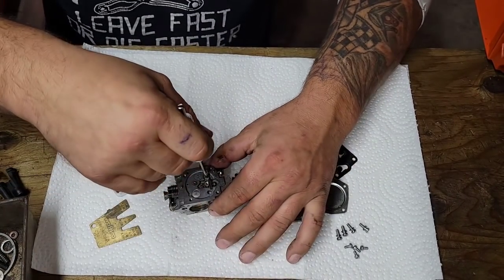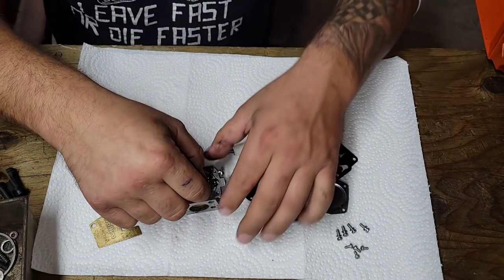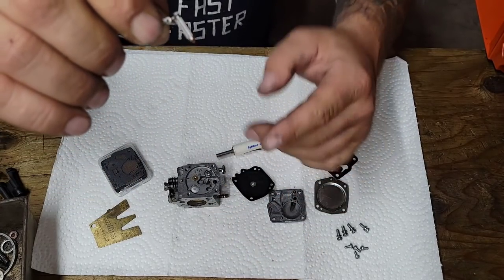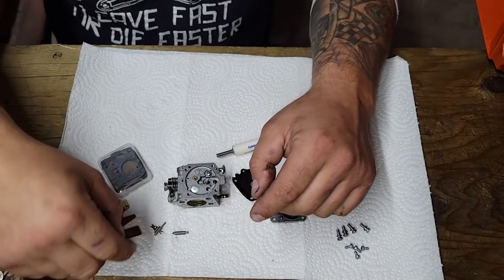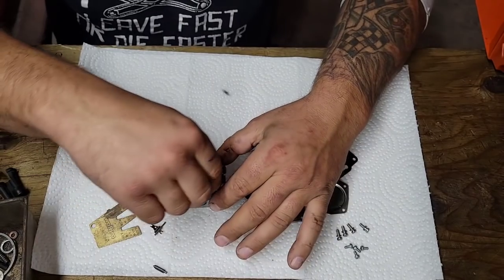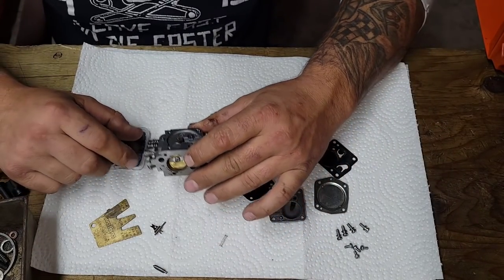Okay, I'm going to take the metering lever out. I don't take the screw all the way out usually. Okay, I'll turn this sideways. There you go. There's your needle. That's usually rubber on the bottom, and that's what seals off. Okay. I'll often inspect these. This one's not too bad. It's got a little ring around it. I usually reuse the factory spring on these.